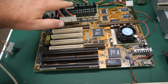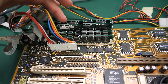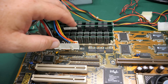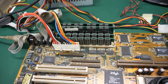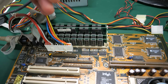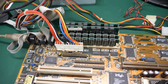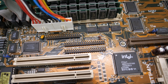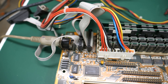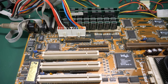It came with a full complement of memory. We'll have to see how much is installed, but anytime I see a motherboard that has the memory still installed, I try to scoop that up because you're almost guaranteed this memory was working at some point, so you know you've got the right type. This is an old-school motherboard — you can see two IDE connectors and a floppy connector down here. We've got serial connectors in the back, so this is the time period where stuff was being built into these motherboards so you didn't have to add separate cards for them.